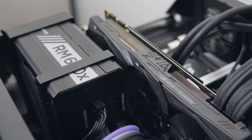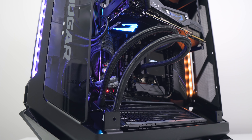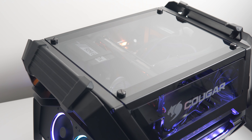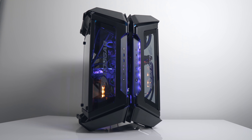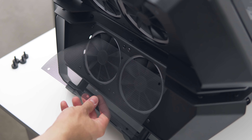For my build in the Gemini X, I wanted to reflect a realistic setup. The primary chamber uses a 16-core Threadripper 2950X and RTX 2080 Ti for streaming or video encoding, and the secondary chamber uses a Core i9-9900K and GTX 1080 for gaming. I would have loved to use the more powerful 2080 Ti in the gaming build, but we're limited to a two-slot card in the secondary chamber. The whole build process was fairly straightforward but took about three to four times longer than usual.